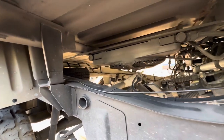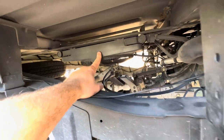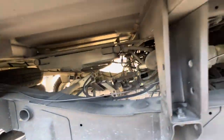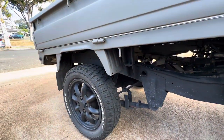This particular truck has AC, so this is your AC condenser up here with a fan. It's mounted a lot higher than a lot of the other models — on a lot of the other models it's all the way down here. So if you're looking to off-road a K-truck, this is probably your best bet as far as models go.